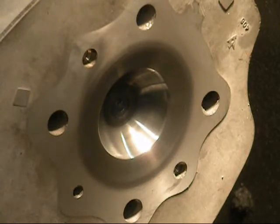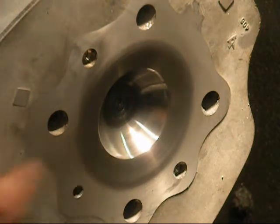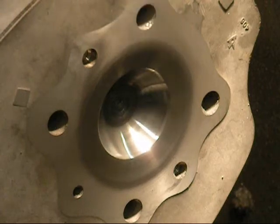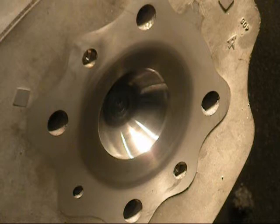I think that's going to be our finished product. We're back at the CC point we want to be. I'm going to lap it next, get rid of this shiny line here, and I think we're going to be good on this. The only additional thing is I am going to shim this spark plug in the back - I'm going to put a spacer in it because it's starting to get kind of close to the piston. Theoretically, we removed quite a bit of material, so I'm just going to shim that and check it and see how it goes.